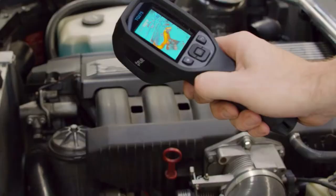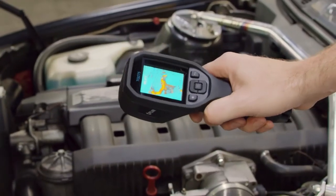In a motor, if it's having high resistance, you can see the actual temperature arising. And sometimes maybe you can't feel it if you were to touch it. So being able to see high resistance, either mechanical or electrical, is very valuable.